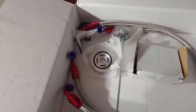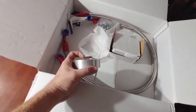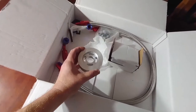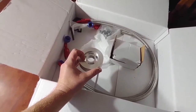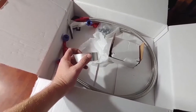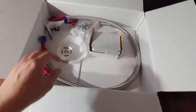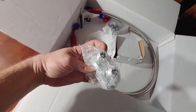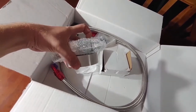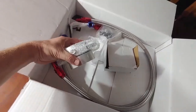What else is in the kit? Imagine where the oil filter goes on top of the car. If you were to take off the oil filter, this would be the sandwich plate that goes on top of the oil cooler. The oil cooler is that portion below the oil filter that circulates coolant and helps keep the engine oil cooler. Then you'll have this piece where the lines feed through, which goes on top of that, and then the oil filter up here. We're going to have a tall stack of stuff going on — hopefully it all fits underneath the hood.